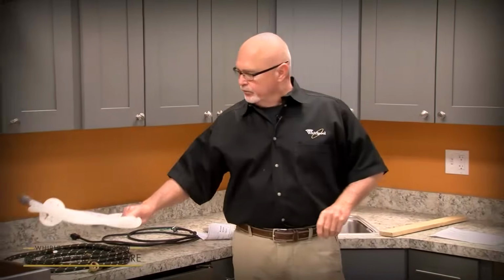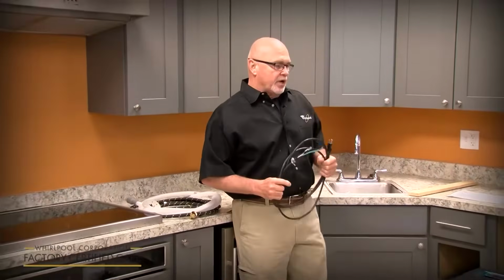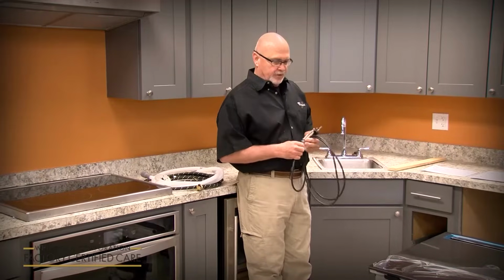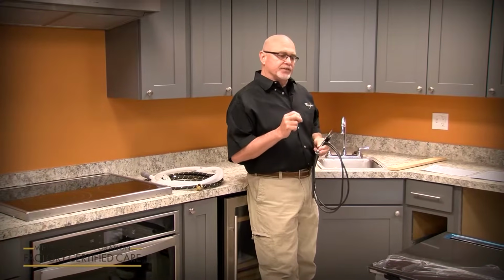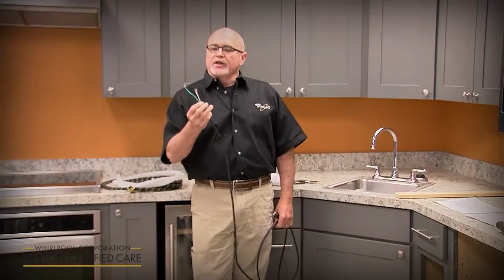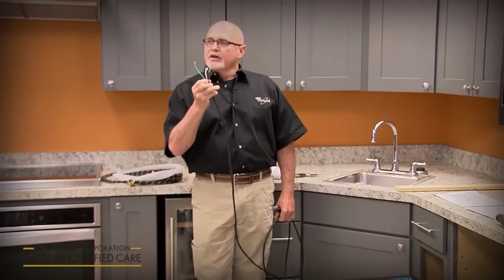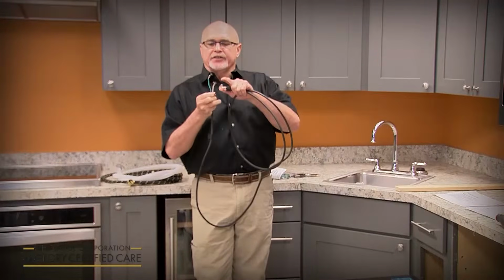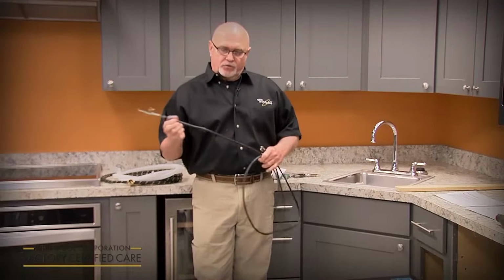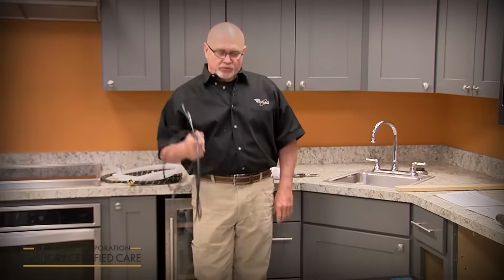Drain hose is supplied with the dishwasher. You also need a power cord. Now this model line has 2 new power cords as accessories. We've gone away from the old wire nuts in the terminal box to an actual terminal with screws. So the difference in the power cords on the end, on the green, the black, and white, there's actually eyelets on it that you're going to put a screw through it into a terminal box rather than the old style wire nuts. So the customer or the installer will need to purchase or supply the dishwasher with the power cord.